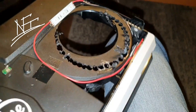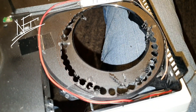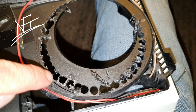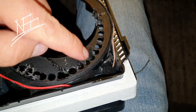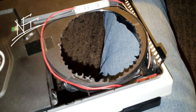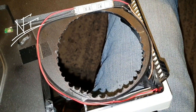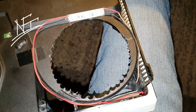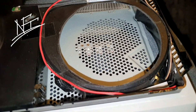I made lots of small holes in a line using a 6mm drill bit — easy way to cut through if you don't have other tools. Then I cut it all clean with a knife. Right now it looks rough, but I'll clean it up with the knife to make it nicer. It's about 3mm of material to work through.